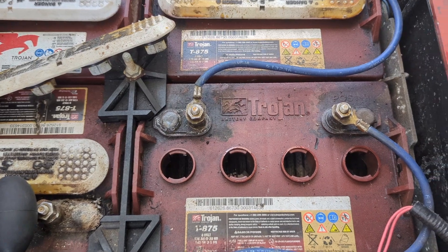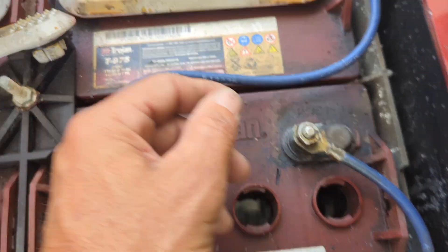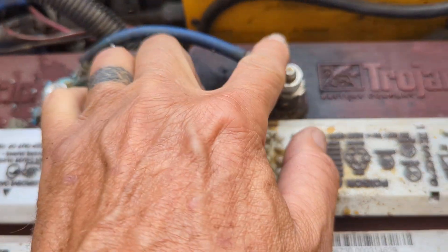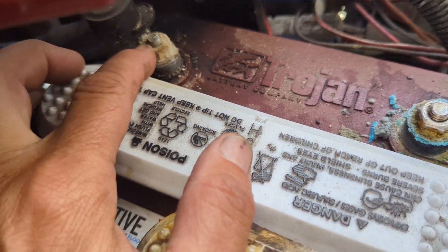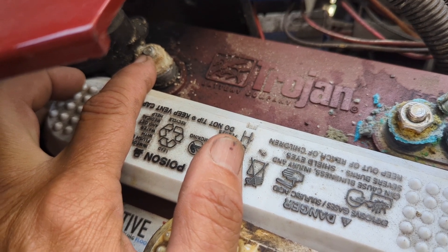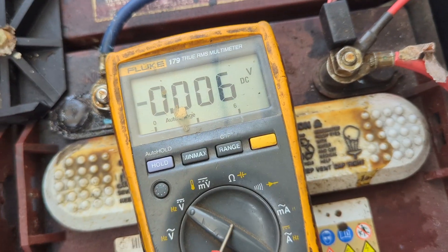When I come out to take a look at my golf cart, I want to look at my cables and look for any kind of corrosion or reduction of the metal. When I start seeing stuff like this, the metal has become thin because of decay and corrosion, so we'll definitely want to replace this particular cable. I've got corrosion back here, so I'm going to take this nut off, clean it, and then use what I call No-Ox — it's a non-oxidation conductive grease that you can get.